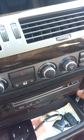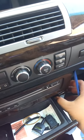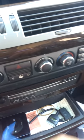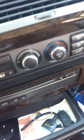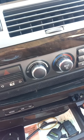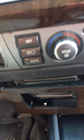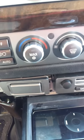Actually, you don't have to pop off these little side panels in order to get the ASK unit out. In order to just get your ASK unit out, you would only need to pop open the drawer and pop off the wood trim that goes around the ASK unit. There are two clips on this side and two clips on the driver's side. You can take the wood off and set it to the side.